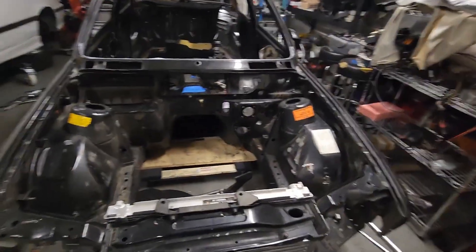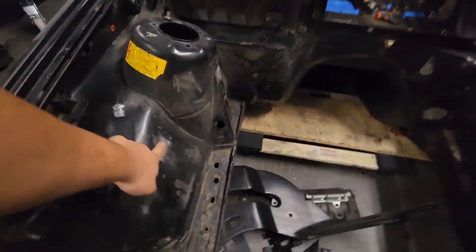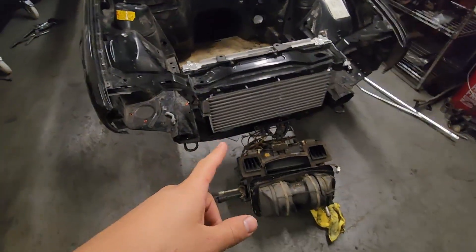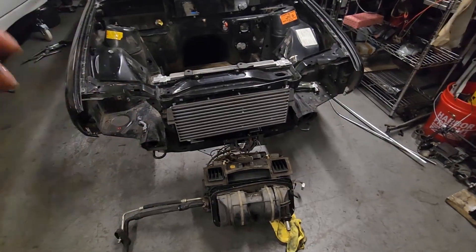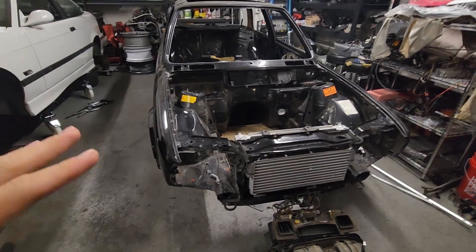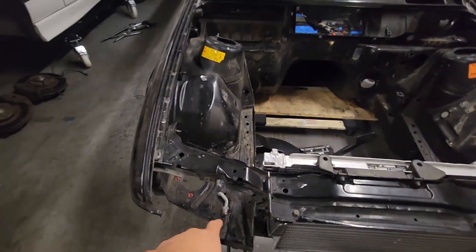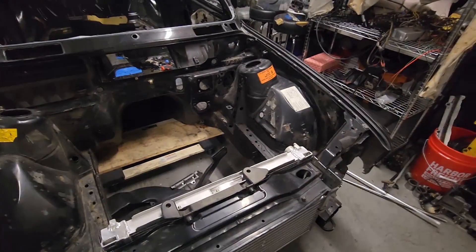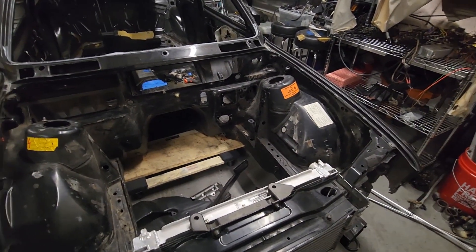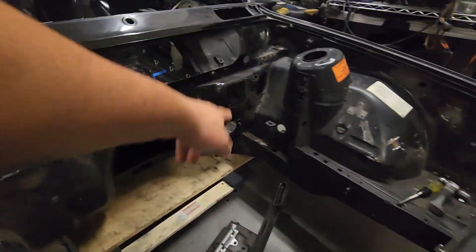Obviously there's no wiring — I am going to shave the bay. I've already started getting rid of most of the extra brackets that were on the chassis. I'm also going to do a removable core support, so most of the spot welds have been drilled out. But I'm waiting to set up a time to have the chassis 3D scanned, so that instead of having to cut out all the delete plates by hand, I'd rather just be able to CAD them out and laser cut them.